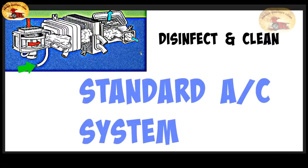What we're going to do is go over a little bit about your system. This is a default system — they're designed differently for each car, but this is how it usually works. You have your air intake here, your blower here, your evap pipe, and your condensation drain pipe right here. This is where you administer your foam and disinfectant — it goes into your air box through your evap, cleaning everything out and killing all the germs. None of it will go into any critical areas.